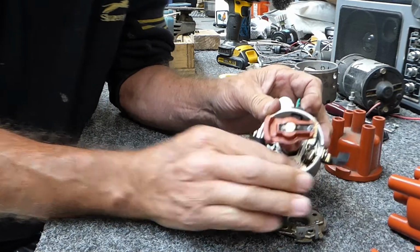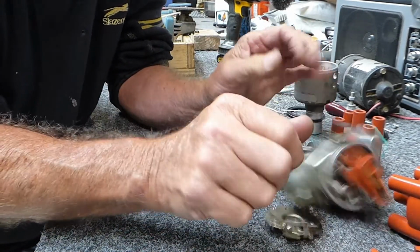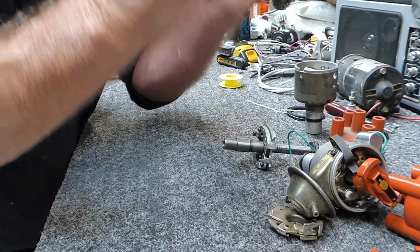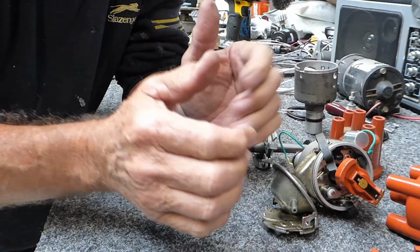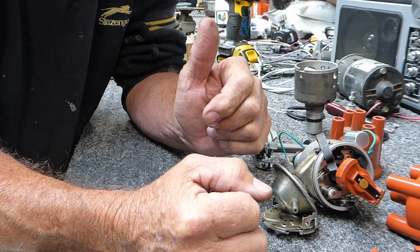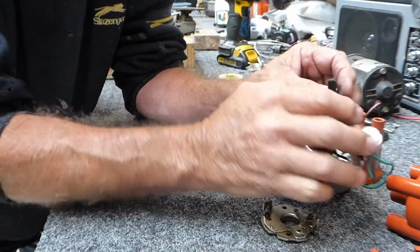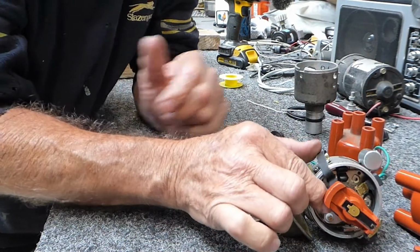Since I set my distributor up like this, my carburetor is so easy to tune. The needles are so sensitive. You hear the motor roaring or flattening off, whatever you want, as soon as I did that to my distributor. I always thought it was a vacuum leak or a crappy carburetor they have, but it was actually setting this thing up properly. As soon as I got this set up, with the extra advance in the front, it runs so smooth in town.